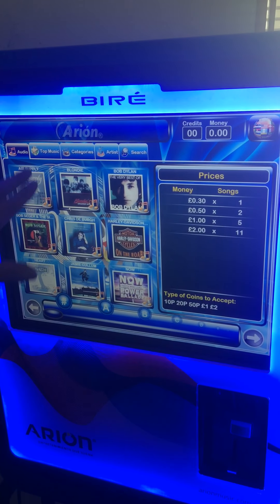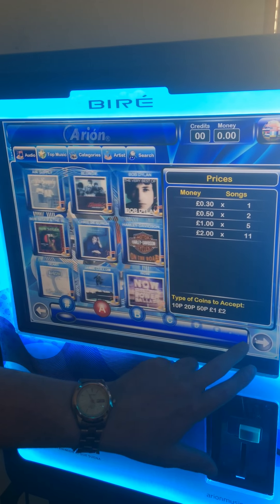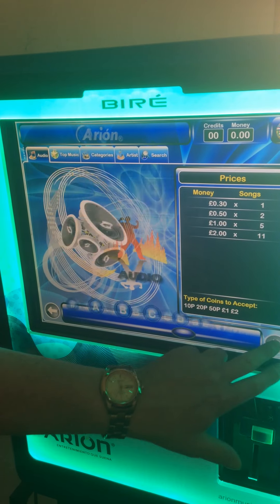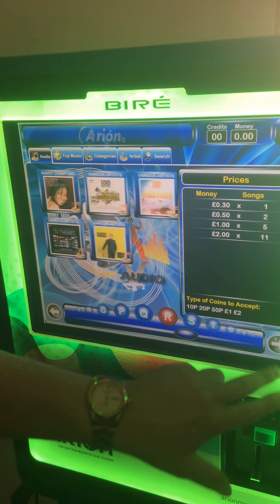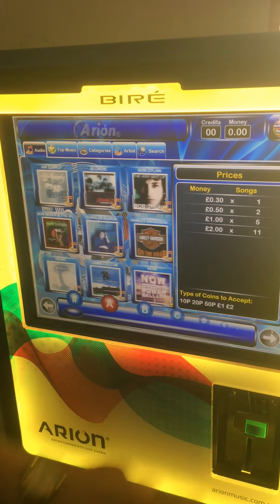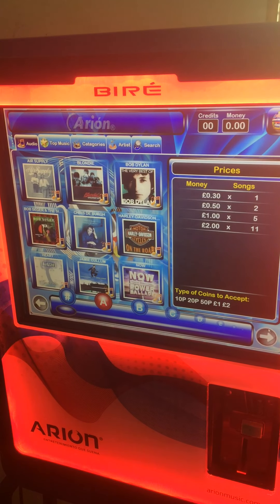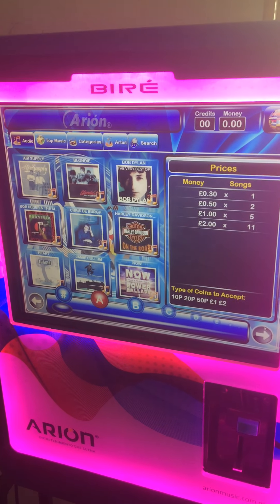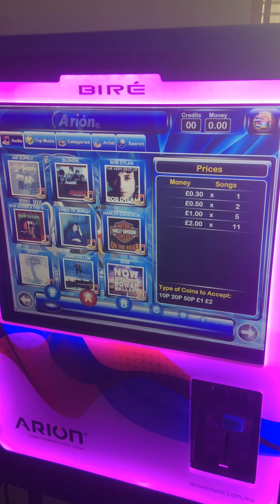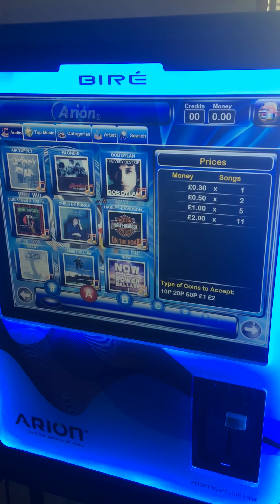The way of telling is that there's limited music on the front of the jukebox. As you can see, there's actually probably 200 tracks — that means that the license code has expired. You need to go to our web page and get another license code, or give us a call and we can give you a license code over the telephone or via email. On the next video, I'm going to explain how you can retrieve your code.